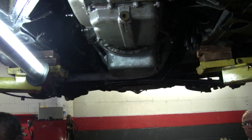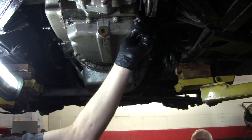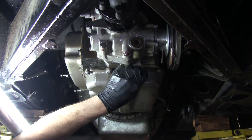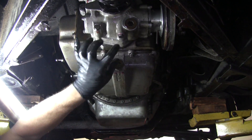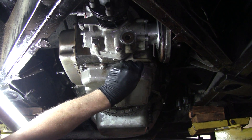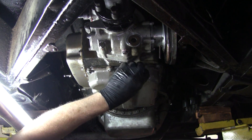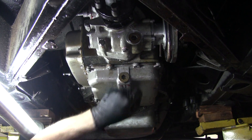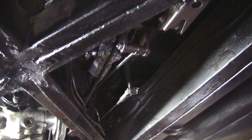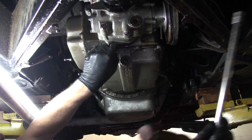The British word for drive shaft is propeller shaft. What's funny is the back part is not called a differential — it's the final drive. On the American cars, they don't have this big unit that uses this transmission. They do have a housing here because that's where the reverse clutch is. But this is part of the braking system that runs off the transmission — this is your servo. That's a dry clutch in there that is mechanically applied and makes the master cylinders apply. So that earlier discussion about converting — all that stuff has to go away, and you have to convert it to total hydraulic. Normally they'll put a booster down here.